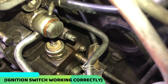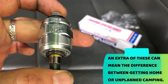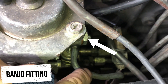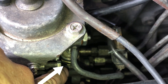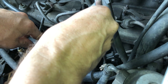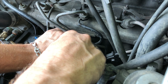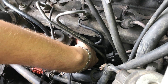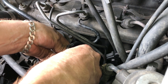Obviously you can't see inside so I don't know if it's actually opening and closing. I'm going to remove this fuel line here so I can hopefully get some kind of tool onto that solenoid. I think this is gonna be pretty tricky to get that solenoid out, but I'm gonna give it a shot. Just brass washers on both sides of that banjo — take the bolt out from the other side.